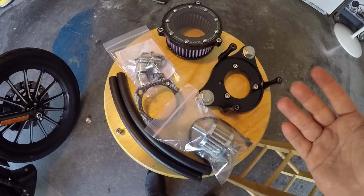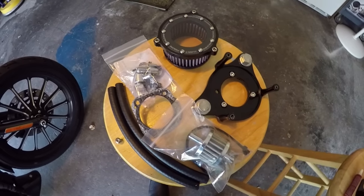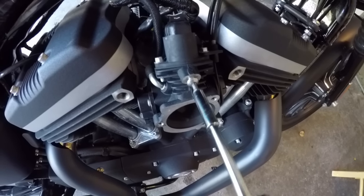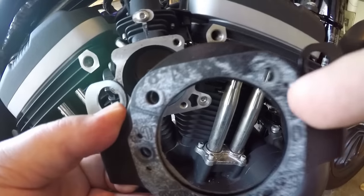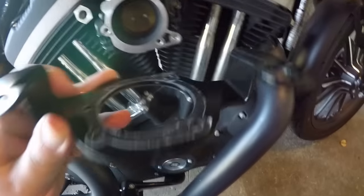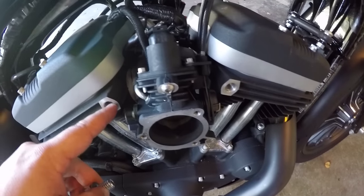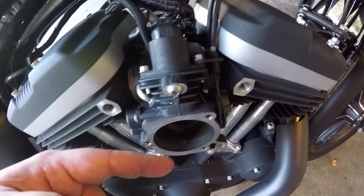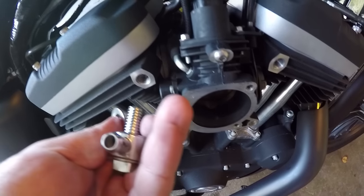Depending on which air cleaner system you've gotten, just follow its instructions and install yours how it says. I'll show you how I install mine. Where the bracket is, there's a little hole — a lot of places will give you a little screw or bolt to go in there just to fill it in and snug it down. Whatever kit you got should have a bracket that goes here. Make sure you have your gaskets — some require one gasket on one side, some require a gasket on both sides. The one I have requires it on both sides, and that's the one you pull off your old intake. There also needs to be a couple of washers or spacers in between to fill up that gap — that's a big factor. Depending on your breather system, the breather bolts may route back into the air cleaner, so I'm going to have a washer, then the bracket, and insert that.